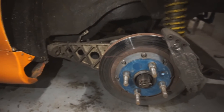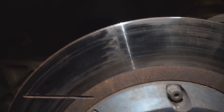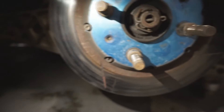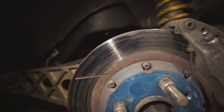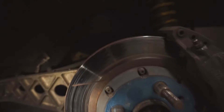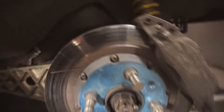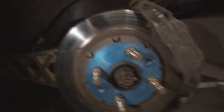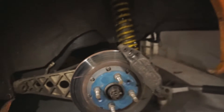So at the rear I quickly jacked it up and checked for play. Whipped the wheels off and checked the pads - pads are still good. But what I've noticed is I have a cracked rotor. I'd usually probably not be too fussed about running it, but there's also another crack at the bottom there, and this one's pretty much the full length of the pad. Depending on whether I can get new rotors, I might just drill the cracks to stop them spreading further - very ghetto, but it works just until I get a new set. I need to double check with Alistair as he might have a set handy.